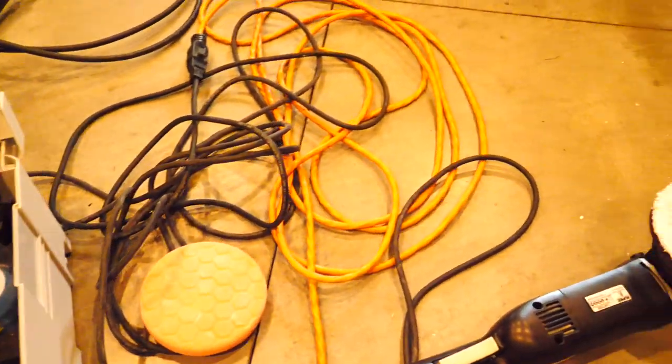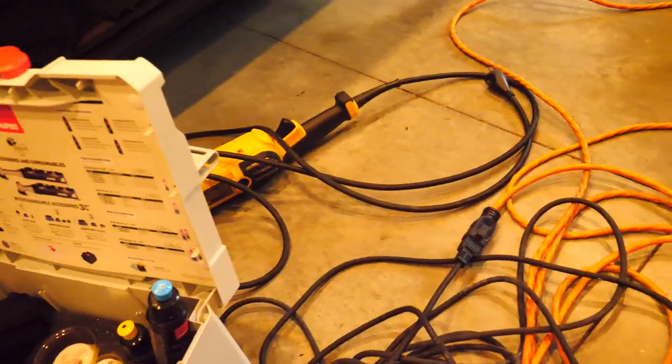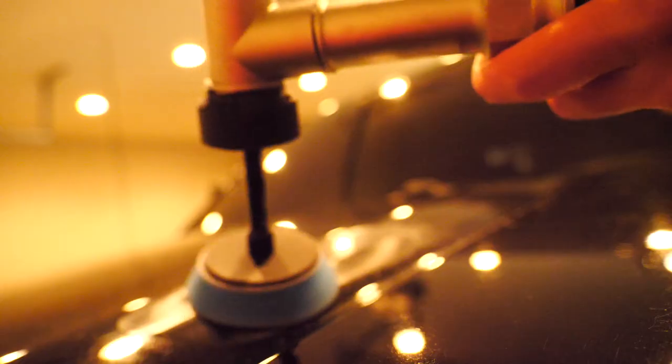For the most part, I used a mixture of 5 different pads, compounds, and polishes. The driver's side was really difficult. I just ended up using the Nano 1-inch with the blue coarse pad and their compound to get the rest of those lines off, as well as the ones on the hood. But it was weird that the driver's side only needed the cutting compound. Anyways, the rotary really didn't do me any good, nor did the dual action, just the 1-inch.